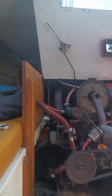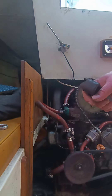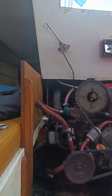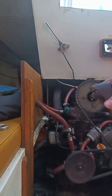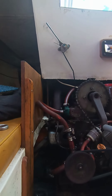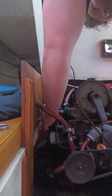So this is the difficult bit — try and actually film it while I do this, we'll see how we go. Obviously you've got your handle on here. You've got to make sure the flat edge lines up in the direction that you want to turn it. This is going to turn in an anti-clockwise direction. If you put it on the wrong way, it would just slip out. So you've got to make sure that you've got that hooked in, so to speak. Once you've got that on, make sure you've got your motor actually switched on, then hit the decompression lever.